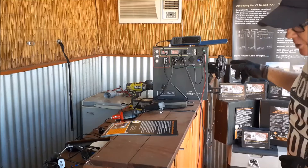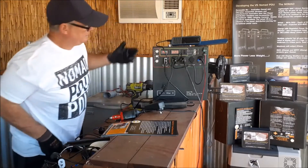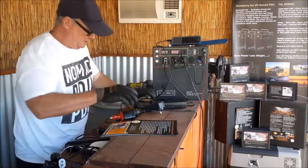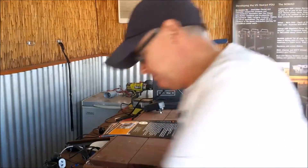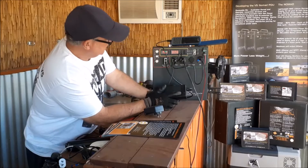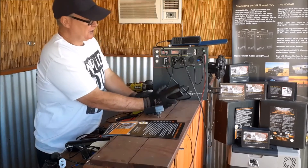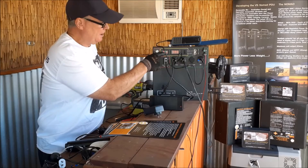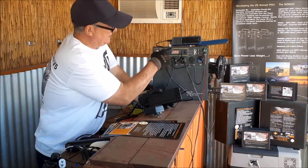I've got the fridge plugged in now, and I've still got the oven and lights plugged in as well. The fridge will kick in in a moment and add another four or five amps. I've left the AC-DC charger plugged in — the red light is on indicating it's charging. We'll get emails saying there must be a fault, but there isn't — it is charging. With a lot of amperage going out, more is going out than coming in. The battery is around 88-90% full so it's probably drawing five to six amps in but drawing eight out.